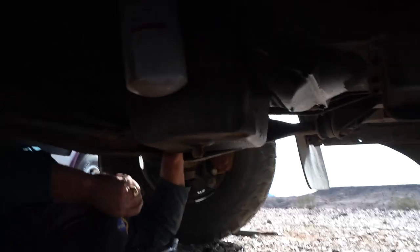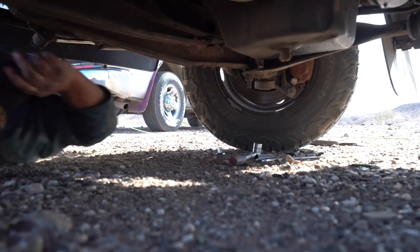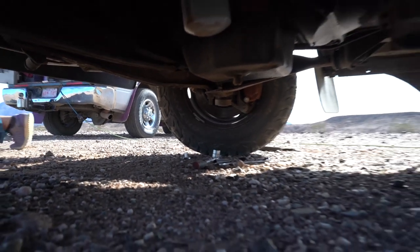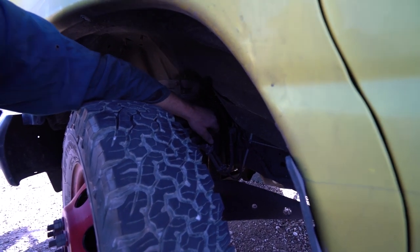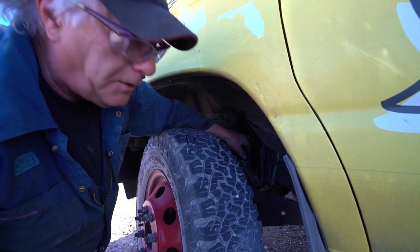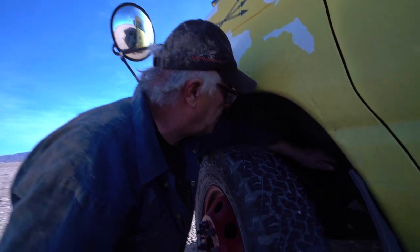Now that makes it fun. Heads up — if you've got an old rusty bus from the East Coast, your nuts will break. And you can cheat by taking a little four or five inch grinder and go in here with a cutoff wheel, right between the rubber, and just cut that right off. Because they're garbage anyway — you're replacing them. But if it spins on us and strips, then that's what we'll do — we'll put the grinder on it.